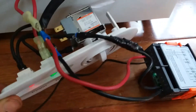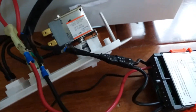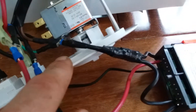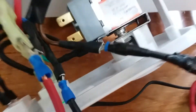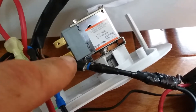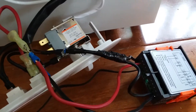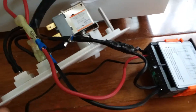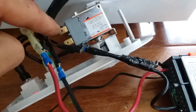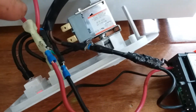If you can't figure it out, get a voltmeter and put it on the proper setting. Put the black side to that green earth wire down there, then tap the red side to anywhere. When the refrigerator is on, as soon as you tap the hot one it's going to show you on your voltmeter that you have 48 volts — on this refrigerator. At the outlet you'd obviously have 119 to 120 volts, but these refrigerators are set up with 48 volts. I tapped around and that one right there gave me 48 volts, so I knew that was my hot wire — the brown wire.